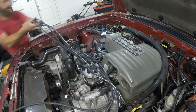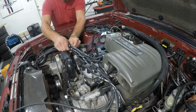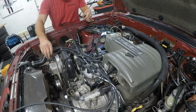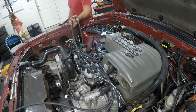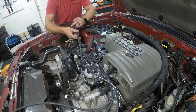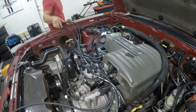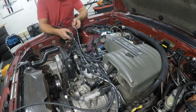As far as priorities: make sure your wires are not going to get hit by any moving parts, and equally as important, do not have them resting on hot exhaust headers or manifolds. If you absolutely have no choice but to run them near something warm, you can get a heat-resistant cover for your spark plug wire or boot to keep it from burning. If you're out of options for routing them away from hot parts, you can always cover them with fire-resistant cloth.